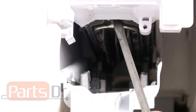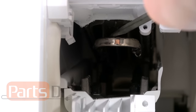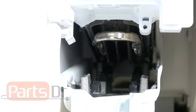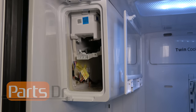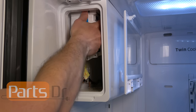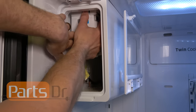Take a flat blade screwdriver and pry down the coil just enough so that when you slide the ice maker out, the coil will stay in place but the ice maker will slide out forward. Then depress the locking tab at the top and you'll be able to grab the ice maker and slide it forward.